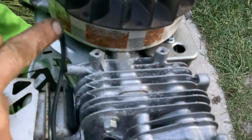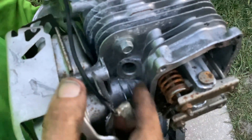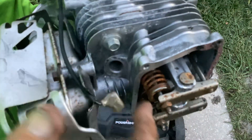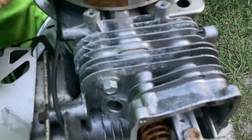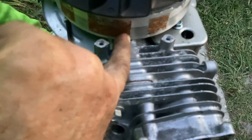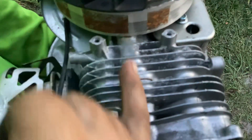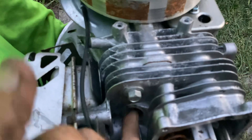With the plug out, here's what I do to get TDC. You can see the metal here versus the aluminum on the flywheel — I go to the center one. You'll have your valve cover off to do your valve adjustment, your plug out. I stick a screwdriver in here. You're going to get TDC, and right around there you'll see that the mark on this side of the magnet is going to line up straight up the middle of the head. It's going to be the right side of the bigger block of the two. That's what I've done to get TDC — mess with the screwdriver and then visually look to see it lines up directly in the middle. That's how you find TDC on these turds.